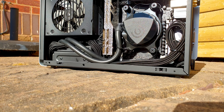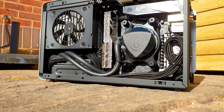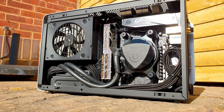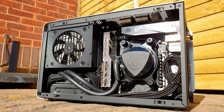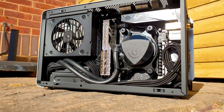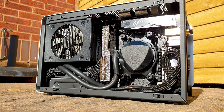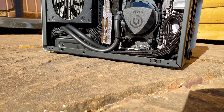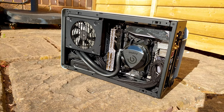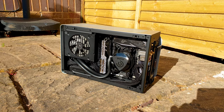So there you have it guys, with these new findings, if a 3900X or even the monster 3950X can offer stock performance on lower voltages like my 3700X did, then green light to install these with the Asetek 645LT. If I can get my hands on one of these, I will gladly test them since I'm so hyped right now with these results, especially that I have discovered that I can control the pump and thus the overall noise.